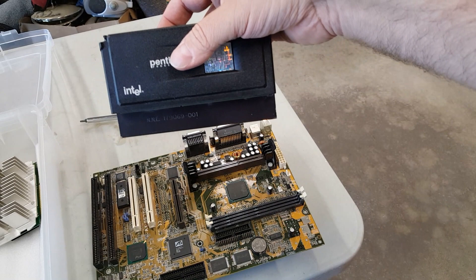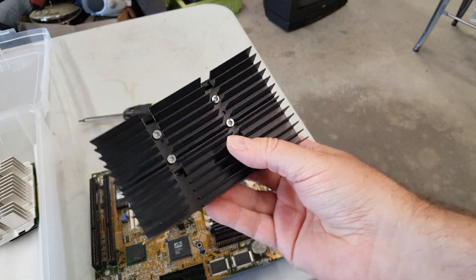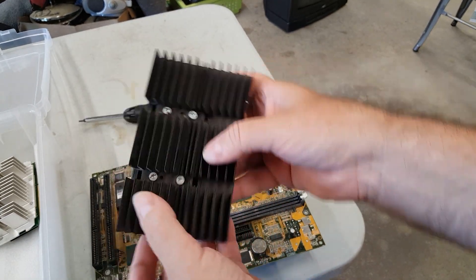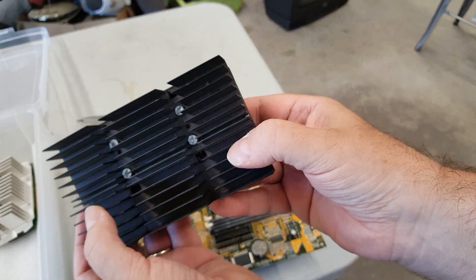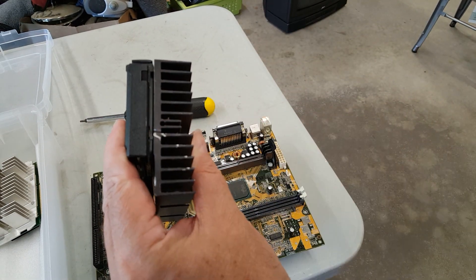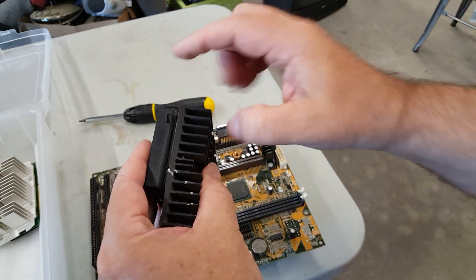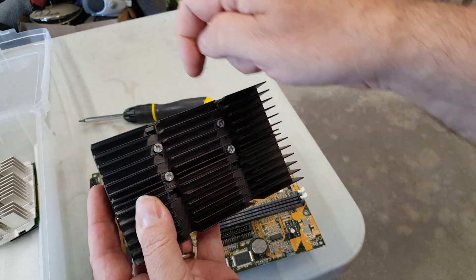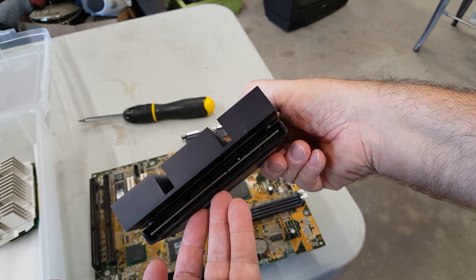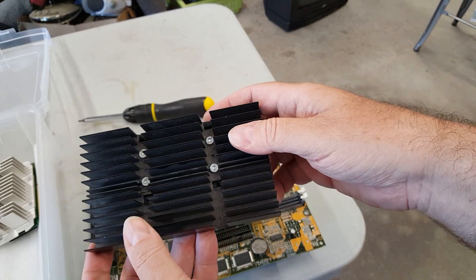That being the case, I can take the CPU off this heat sink — just a couple of screws — but then I've got a CPU without a heat sink. What we're going to do in this video is cut this heat sink essentially in half. We started earlier, but I wanted to finish it on video — cut it right here, save the top half, drill some holes for a fan, and make a nice usable Pentium 2-333 out of this monstrosity.